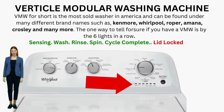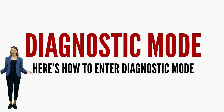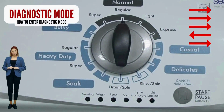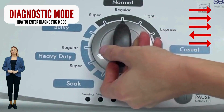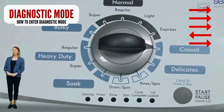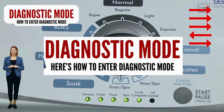Entering diagnostic mode on a vertical modular washer. To get to recalibration mode, the self-test mode, error code mode, and all other modes, you must enter the washer into diagnostic mode first. You will have to re-enter diagnostic mode every time. From there, you choose what to do next by clicking the knob a certain amount of times. If your lights don't blink, try again, turning the knob faster or maybe slower. If it never works, your control board is no good — try replacing it. If your washer starts but doesn't finish the recalibration cycle, change your shift actuator and/or lid lock.